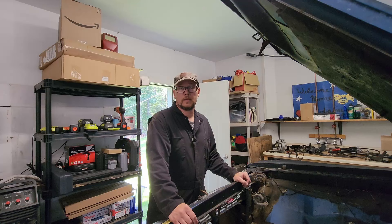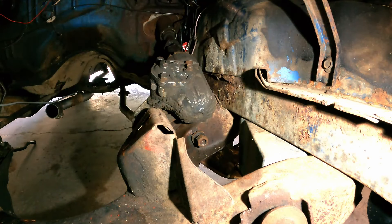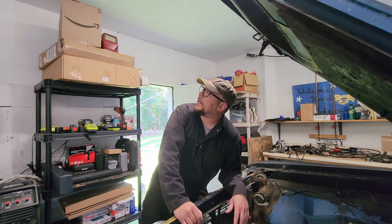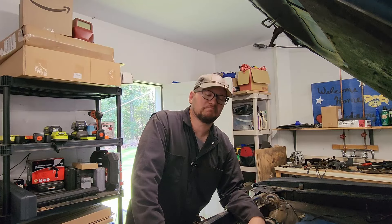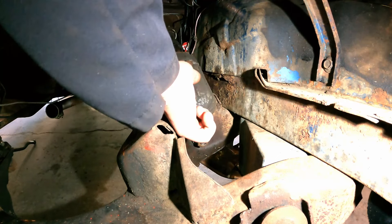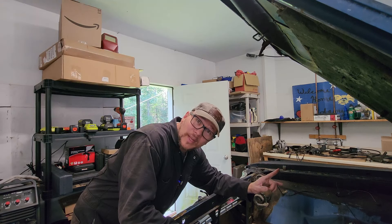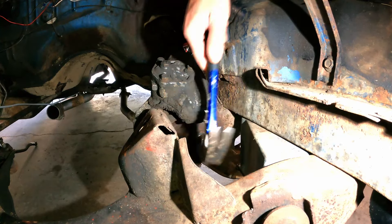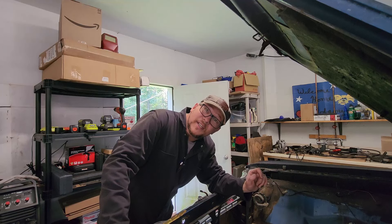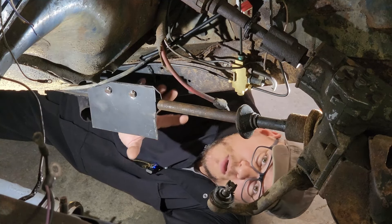This first method is for those of you that don't have any rust or have recently done work on your suspension. We need to be under the hood for this — it's a whole lot easier because there's no engine. This nut right here goes to the pivot for your lower control arm. Best thing to do is just back this off, leave it on a couple of threads, and if your torsion bar is not rusted into place, just give it a few taps and that should get it started moving. However, mine is rusted in place.